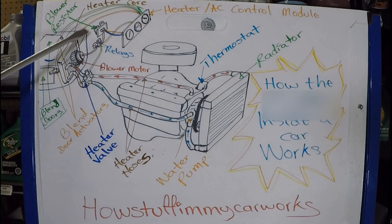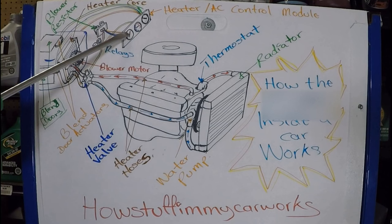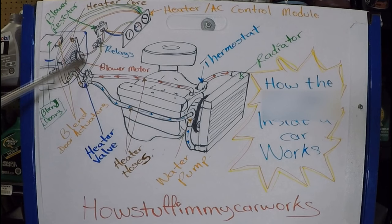Now to make this faster, the heater blower spins and forces air through it so more heat is transferred from the heater core to your car. The heater motor is also controlled through your heater control module. When you turn the blower, it has several speeds. In order to have several speeds, the signal goes through a blower resistor, then through the relay, and then to the blower motor, so it can force the air to pass through and go through the vents.